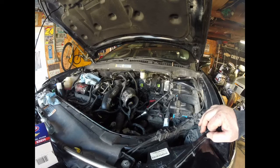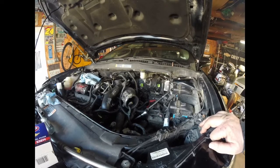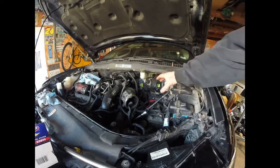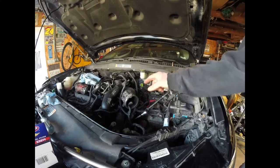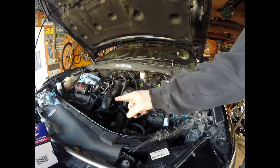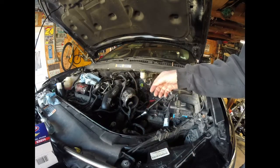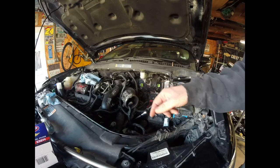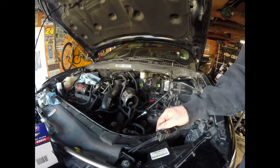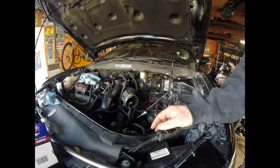I have already done what I need to do, so the starter is back on, but I haven't put everything back together yet, so I am going to go over what you have to take off and what you have to do to get to it. On the top you have to remove the battery tray, the air box, and then you have to remove your shifter cable. The reason for that is there is a bolt on top of the starter that is really hard to access — you can't even really see it from here. I had to use a long extension with a knuckle and a 13mm socket and kind of get down in there, moving some heater hoses out of the way.